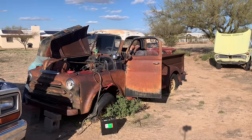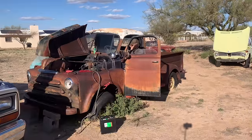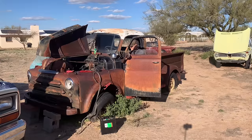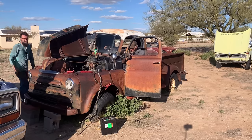It's popping through the carburetor. All right — it ain't going to go. It ain't going to run. So we weren't able to get it running. We're fighting a couple things: low compression on the cylinders that have compression, and two of the cylinders were completely dead — we're 100% sure the valves were stuck open because it was also popping through the carburetor. The fight might not be over yet. I think Joe will let us come back out there, and if we bust the head off, pop the valves back down, make sure they're all working, and put the head back on, it would probably run. The story on the 1949 Dodge might not be over yet.